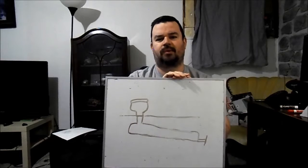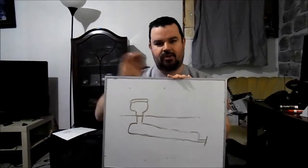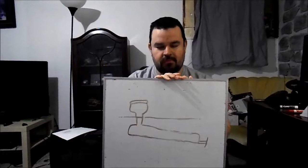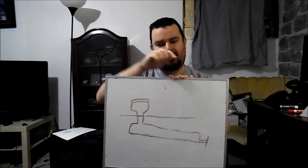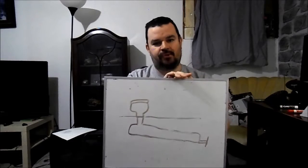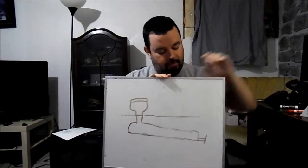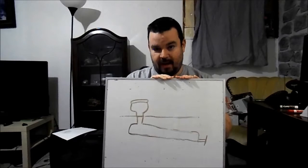The nice finishing touch that really makes a difference is what we do at the dump station. We pull the trailer up, put my gloves on, go outside, pull out the sewer hose, slip the bayonet fitting on — definitely recommend wearing gloves, not only because you're dealing with sewage but also because the bayonet fittings can be snug and the cap on the sewer connection can be tricky to get off. Gloves give you better grip. You hook up the sewer hose, and the first thing you always do — any experienced RVer will tell you this — is black tank first.